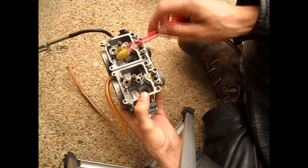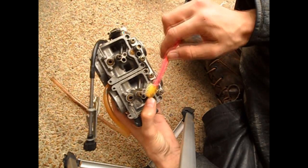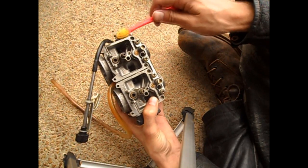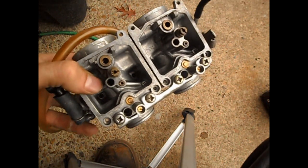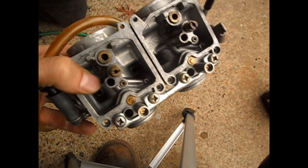These two things here are your main jets, I believe. The pilot jets are down in there, if I'm not mistaken. They're both going to need to be cleaned out. The gelled gasoline came off pretty well, but a lot of oxidation was left from moisture that was in the carbs.